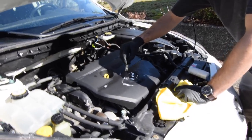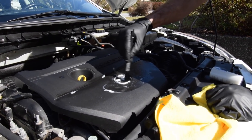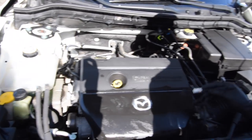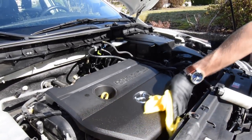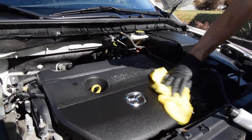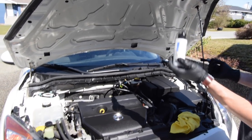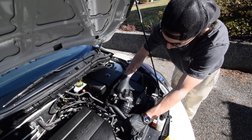You don't have to use a brush for this part, but I like to because in all the cracks and crevices, if you go at it with the brush the finish looks more flawless when you're done — no spots where you clearly didn't get. Whereas if you just use a rag to rub it in, you can do it quicker and it'll probably still look pretty good, but there will be obvious spots you missed. Look at that — that is perfection. That's the finish you're going for. So we're going to do the exact same thing across everything: dress it all up, get into all the little grooves and nooks. If you don't have a brush, you just can't get the same finish.